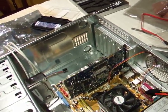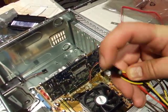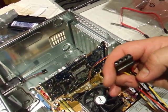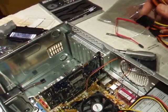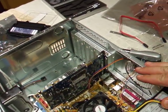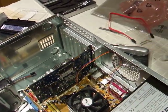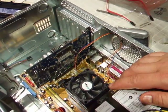If it fits somewhere — and most of them are shaped in such a way — you'll notice that this connector has rounded edges on one end and square edges on the other. If you're trying to push it in somewhere and it doesn't go, don't force it. And if you try and push it the wrong way and force it in, then you deserve to break your computer. These SATA ones plug in very easily. If you get stuck, ask somebody who knows, do a bit of research, look at diagrams in your instructions for your power supply or your various items. You won't go too wrong.